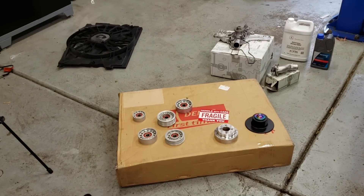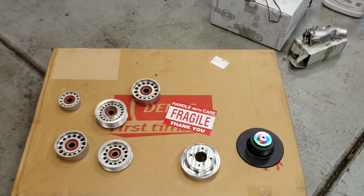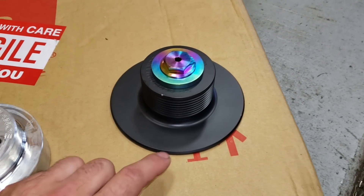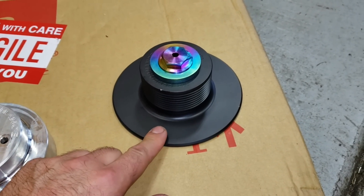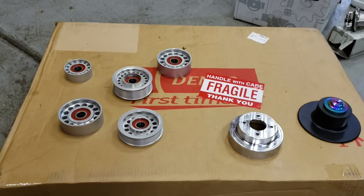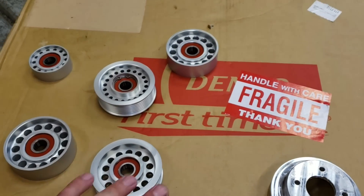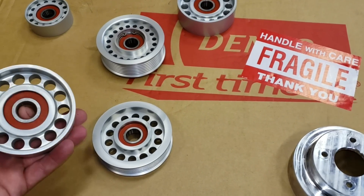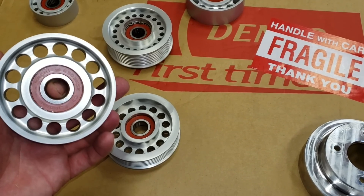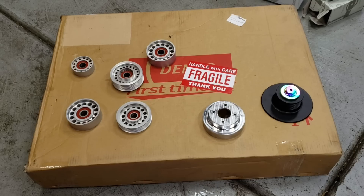Here are all the parts I'm going to be replacing — say it with me: while I'm in there. Everything you see right here came from Victory Road Performance in Virginia. I have their clutched supercharger pulley, but I had a 76 millimeter pulley and I want more boost, so I went with a fixed 72 millimeter pulley. I'll go over the difference between fixed and clutched in a minute. We also have a new bolt and washer as part of a dress-up kit, plus pretty much all the replaceable pulleys for the M113K — these are billet pulleys with NTN/Koyo bearings made in Japan. I'll leave a link and a 10% off coupon code for Victory Road Performance in the description.